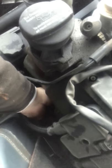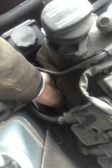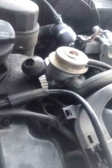Let me check the plug with a finger really quick. The dry finger. Oh, go down here. Okay. Right there. So that is just valve cover leak, just going down. You can tell it's right there, it's going down. Okay. So plug this monkey back in. Be careful with these, because they are sensitive as hell. Okay. So plug her back in. Right there. You'll hear it click.